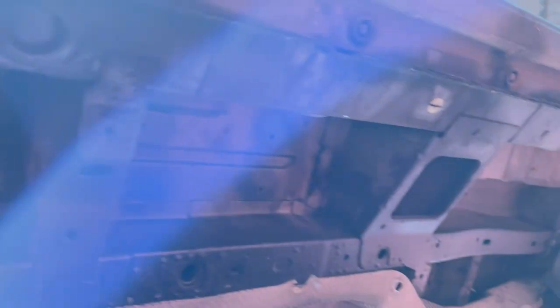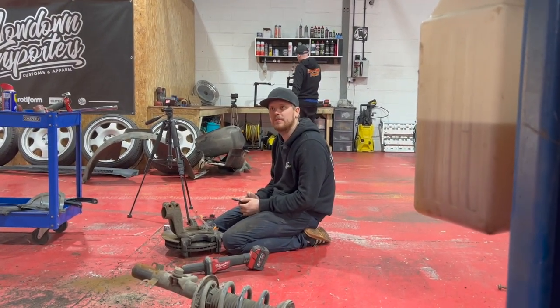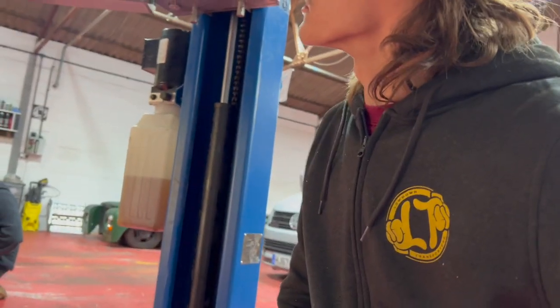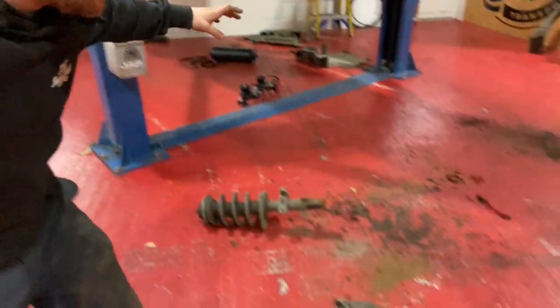So we've changed that, one bolt in the middle, changed the seals, do the bolt back up — pretty easy to be fair. Now I'm going to jump on and get all the arch liners and under-trays off so that we can start running lines for the exciting bit of the air ride. So we've got all these plastics off now. I've got all the holes drilled up for the tank and just put the riv-nuts in there — got some Hoof on there so they don't rust away, same with the compressor ones. Compressors will go up under here, tank at the back here.